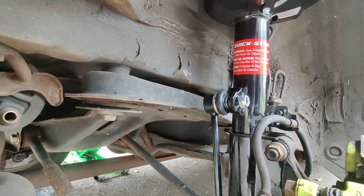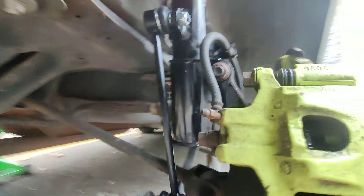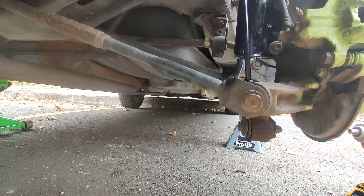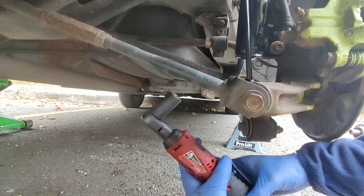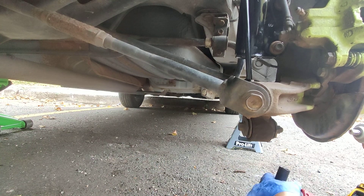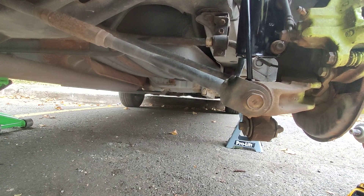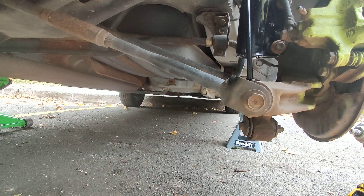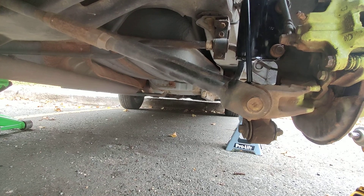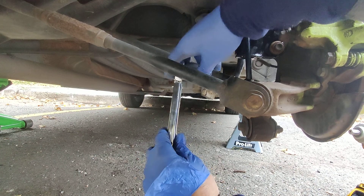I forgot that one is 17 — you see the size changes, this one is 17 now. I'm going to torque these down to about 58 foot-pounds, I believe. Just check your manual to make sure whatever the torque spec is, just to be sure. So, my little torque wrench here.